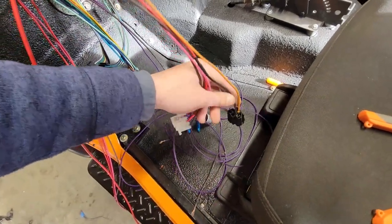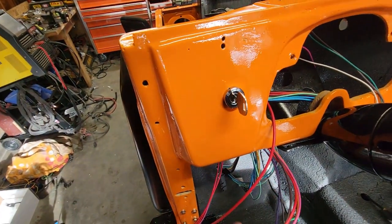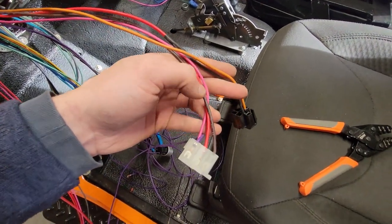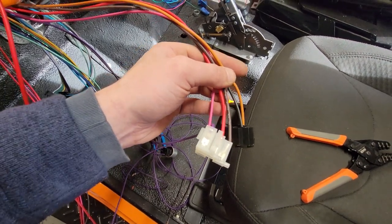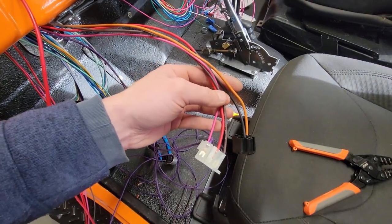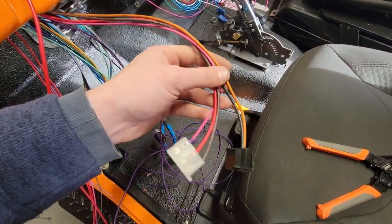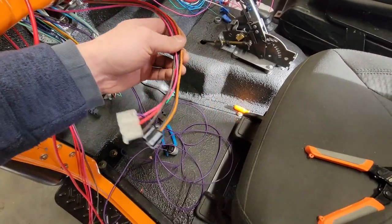This stuff we are going to eliminate the plugs off of, because this is the ignition switch. And just another reminder, we wired up our ignition individually earlier in this video. So I'm going to steal a couple things off this, the accessory power, for example, to run the radio and stuff, and also the main ignition switch power, which will switch on this whole system, which I need, just to make sure that the lights and things only work when the key is on. I will eliminate the connectors, and then any other wires in here, like the power, which I do not need in this situation, I will eliminate at the source.